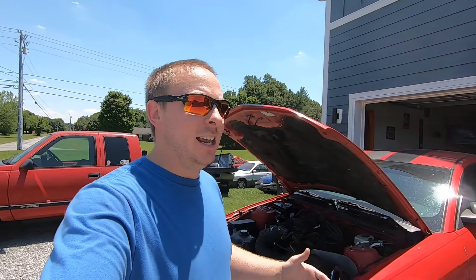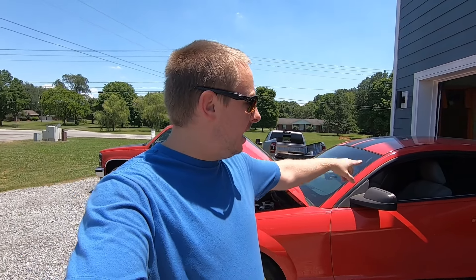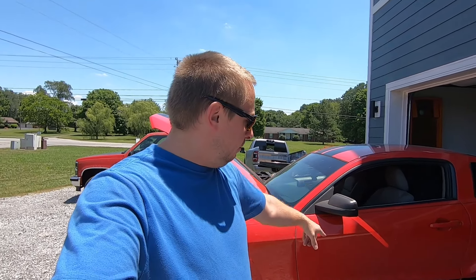So since last video, I've actually done a little legwork to make this video move a bit quicker into getting this thing running. I already hot-wired the fuel pump, replaced the fuel filter, and drained all the fuel out of this car. I burned it last night and it was a very, very slow burn. It's been sitting for a very long time — I think way more than a year.